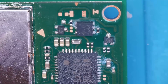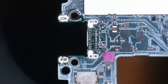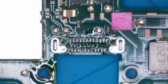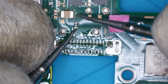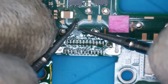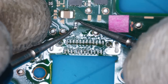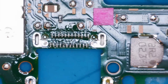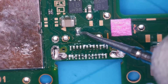We've got a nice clean pull of the charging port. The meter is in continuity mode — the mode that beeps when we have a complete circuit — and we're looking for shorts. I'm testing the fuse first. The fuse is definitely gone. Maybe that's all that's wrong with this switch — the liquid damage has gone around the board, blown the fuse, and that's what caused it to stop charging. The indestructible fuse is no longer so indestructible.